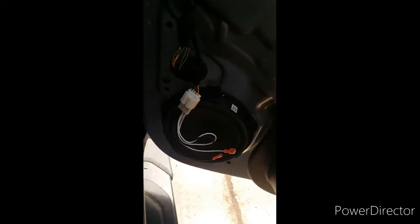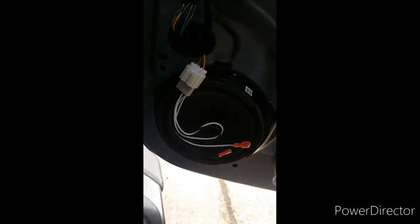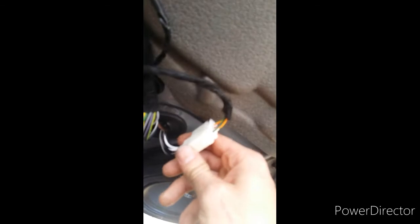If I'm taking the door panel loose, I unhooked the lock switch and hung the panel so that I didn't have to disconnect the door lever cable. Now I'm going to pull the factory speaker loose and put in the aftermarket speaker, then run the wires through that grommet and back to the rear. The speaker was going to hit the motor, so I had to use a spacer in between to pull the speaker off the door a little bit to keep it from hitting the window bracket as it comes down. Harness in, push the extra wires back through, wire going up for the tweeter, woofer is mounted, three wires ran through.